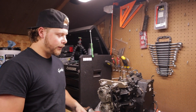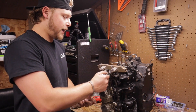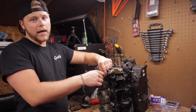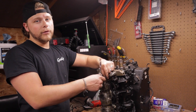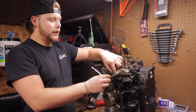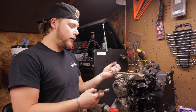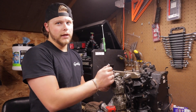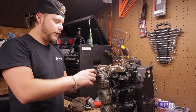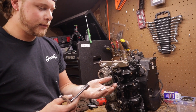Next up, we're doing the whole front. Starting with the timing marker — two three-eighths bolts on top. From there we'll move to the carbs. I'm taking the carbs off as a stack. I won't show carb cleaning here, but I have a separate video cleaning the carbs on a 75 horse — they're identical. Especially if you're rebuilding the powerhead, you don't want dirty carbs making it not start after you just rebuilt the motor.